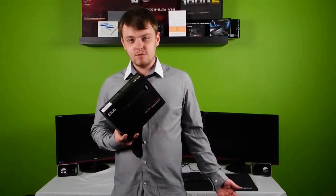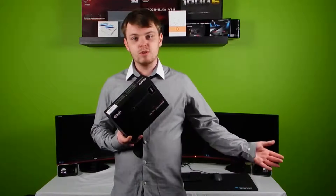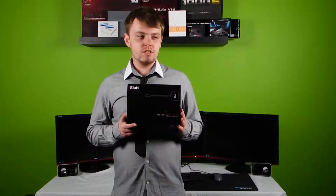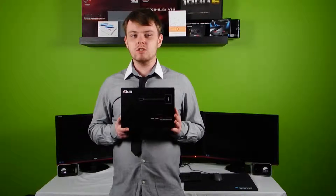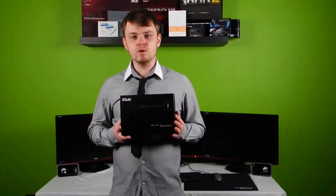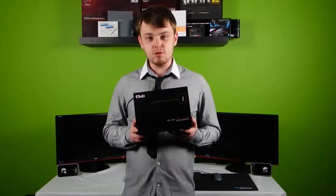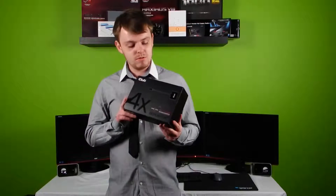It comes in a variety of different sizes. You get one DisplayPort to another, you get 1 to 2, 1 to 3, 1 to 4, with 4 being the biggest. Now, why would they bring out one of these? Well, the bandwidth in the DisplayPort is quite large — big enough for like an 8K screen. But if you've got three or even four 1080 screens, you've still got the bandwidth there in that one DisplayPort cable, so they came out with this.